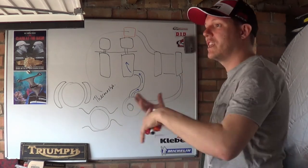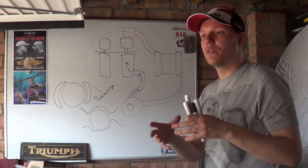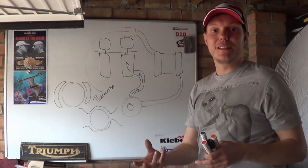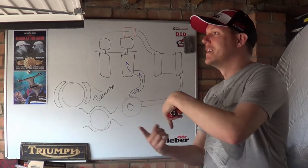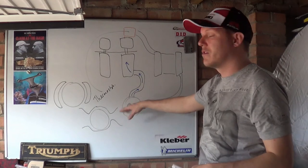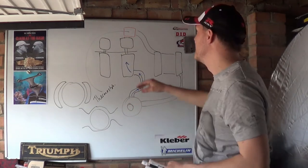Now, there are viscosity losses and all the rest of it, but that's why you have an open cell impeller. When you look at the impeller for your water pump compared to your turbo, you'll notice the middle's missing, and that's so we can just have this vortices. So this thing can just spin away and basically create turbulence inside your water flow, but not actually apply a pressure to anything.